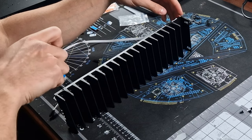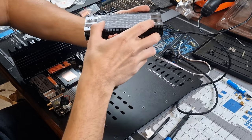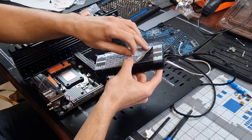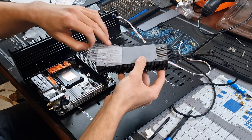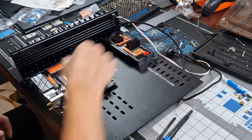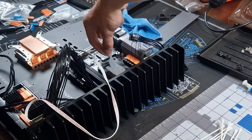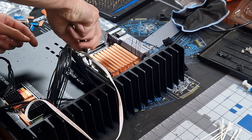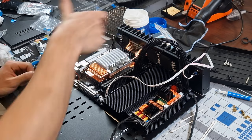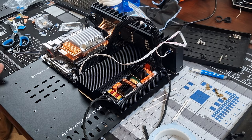Returning to the case assembly, I made sure to use the bottom panel for heat dissipation. I added two 3mm thick thermal pads beneath the CPU socket and placed a thin 0.5mm thermal pad for the PSU, allowing it to touch the bottom panel for effective heat dissipation. I connected the cables and proceeded to install the CPU block and heat pipes. I also added smaller heatsinks around the block and a larger one for the bottom panel to maximize surface area and thermal mass.